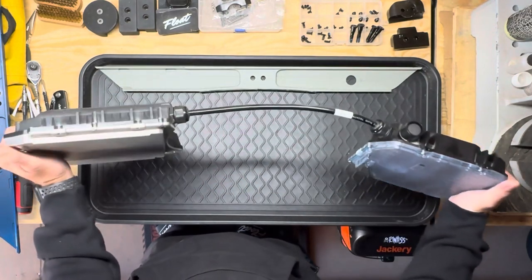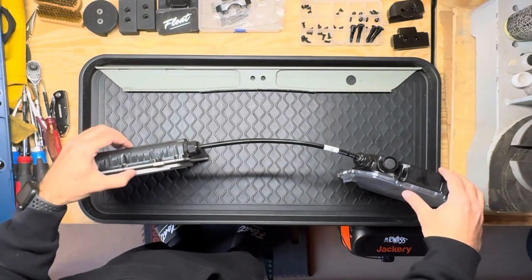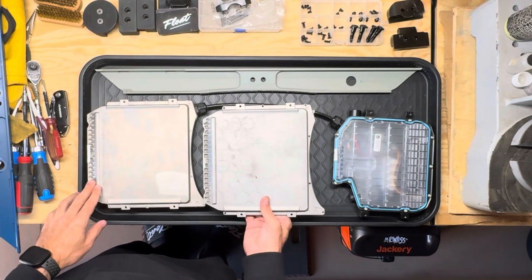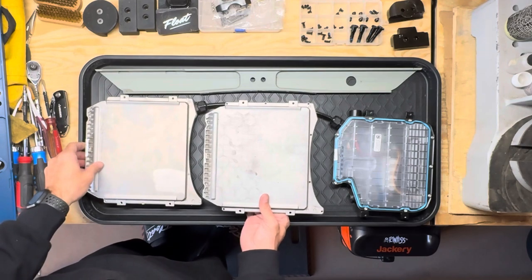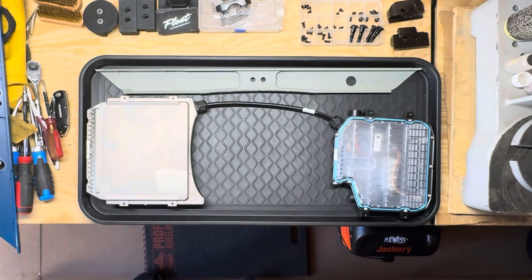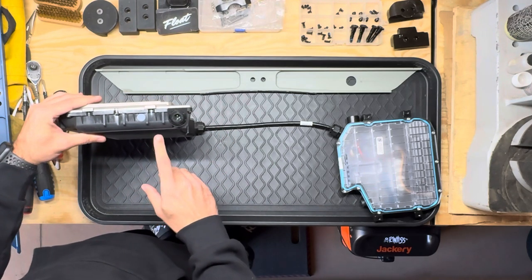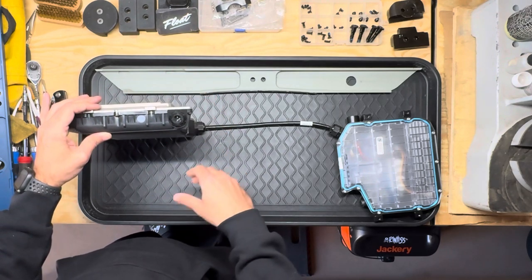This is the XR Classic battery enclosure and the controller, and this is thinner as well. I took some calipers and went from the screw hole here on the lid. By the way, the lid for this enclosure is the same exact as the GT — and I would also assume, potentially, the GTS. I don't have a GTS disassembled, but I do know that the GTS has the same outer profile because I can use the TFL gaskets on it. These are the exact same lids for the battery box. So the other thing: I did measure from here down to here. It's kind of diagonal so it's not exact, but the rail just goes up to this little lip, so technically it is thinner than the GT battery enclosure.